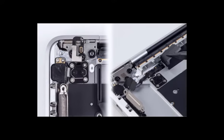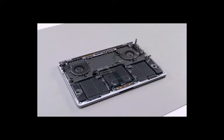The Touch ID board and the logic board are paired. When replacing one, you have to replace the other. The steps for the 13-inch model and the 15-inch model differ in two ways: location and flex cable shape. For the 13-inch model, the Touch ID board is located directly below the display hinge in the corner of the top case. For the 15-inch model, the Touch ID board is located a bit farther from the display hinge. Also, its flex cable is shorter and underneath Mylar tape. We'll focus on the 13-inch model for this video.